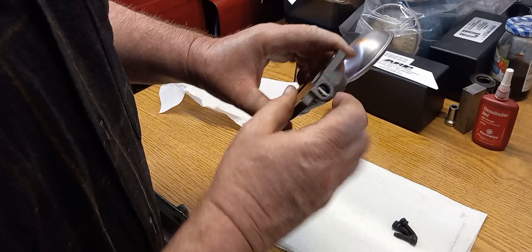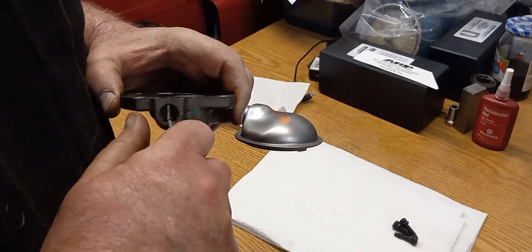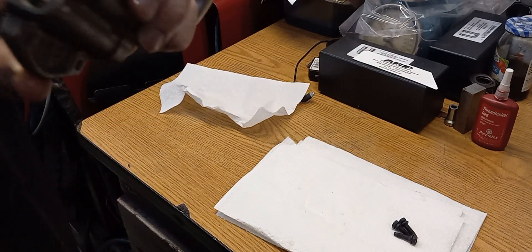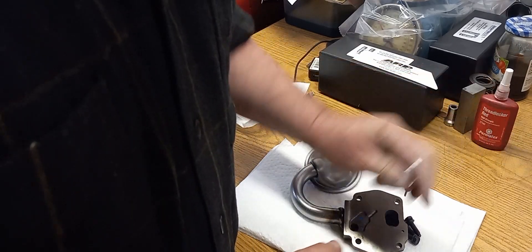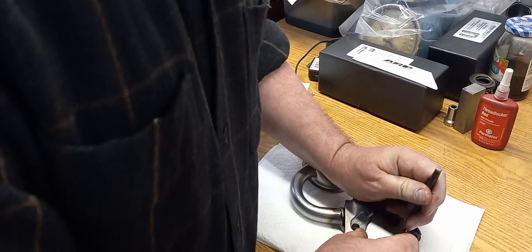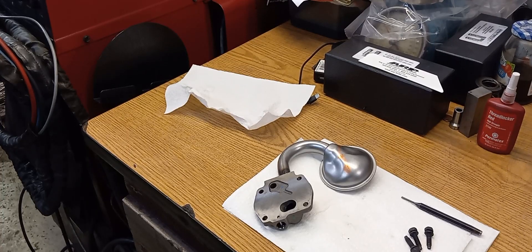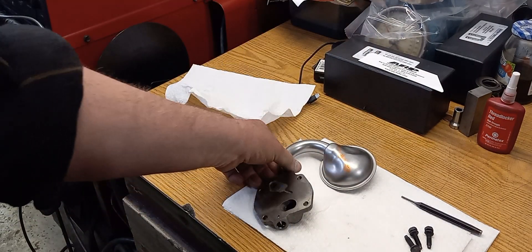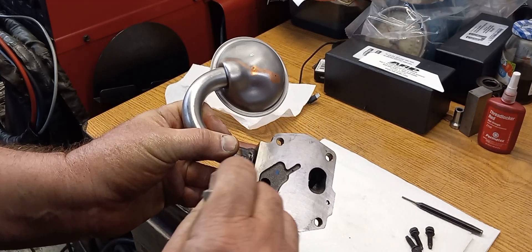It's all together. There's a little burr there — we're going to scrape that burr off, wash it again, and blow it out with air. Sometimes I'll just take the punch, set it on the side a little bit, and close the hole up. To check the bypass valve, I use a little O-ring tool that I've modified — something with a little hook on it. You can go in the hole and push on it, feel it moving, just making sure it's free and clear with no grit on it.